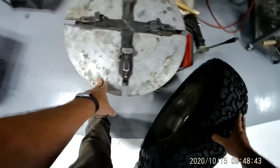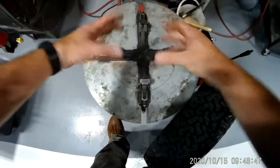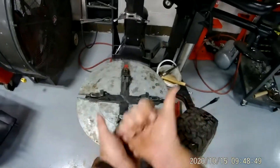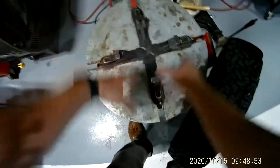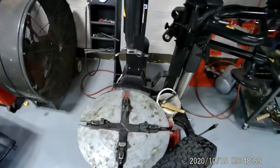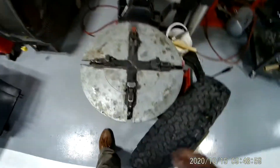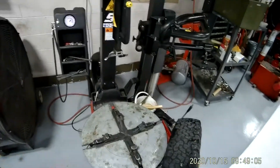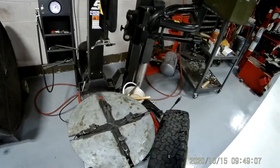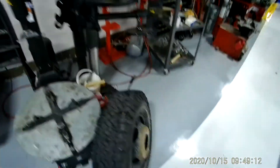This right here is your turntable, and these right here are your clamps. They can either clamp the tire going in or going out — most of your automotive tires will be clamped going out. You can adjust these for different wheel sizes and whatever application you need. These right here are air jets, and what they do is force air when you're trying to mount the tire to the rim to sit the bead and help it seal.